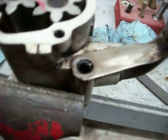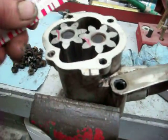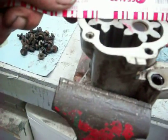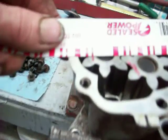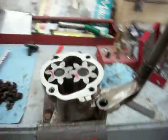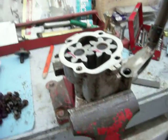Basically, you clean out the oil pump really good, put it back together, and lay two pieces of plastigage on there. When you check it out, like this one right here, it reads six thousandths. That means it's just at the point where it's in spec — one more thousandth and it's out. So I'm not going to take the chance with that. Let's just get another one. That's how you do it.